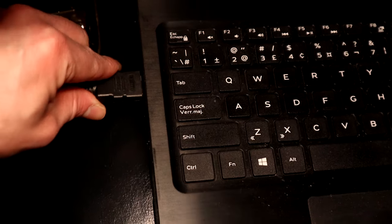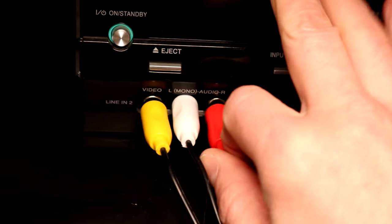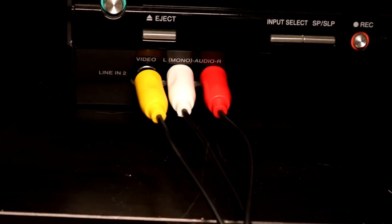There are actually a lot fewer options. If you're like me and you just pull the trigger on something, you might end up with something like this — an HDMI to RCA adapter. It does do what I want: takes HDMI out of my laptop down to RCA into a VCR, hit record, and it goes on the VHS. But this item actually takes the widescreen aspect ratio of your laptop and squeezes it to a full screen aspect ratio. It doesn't crop it the way I was hoping.